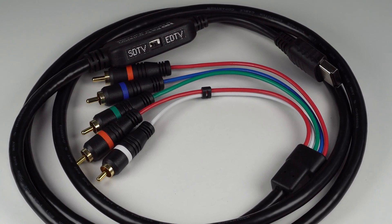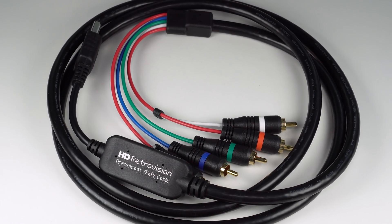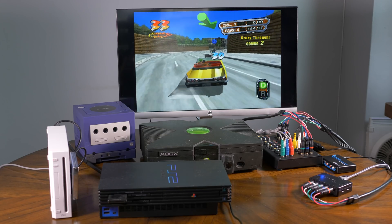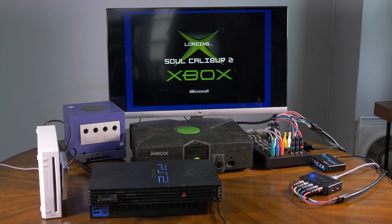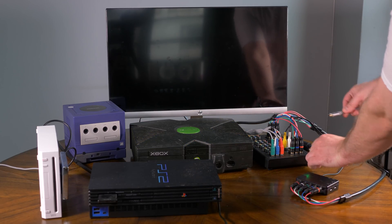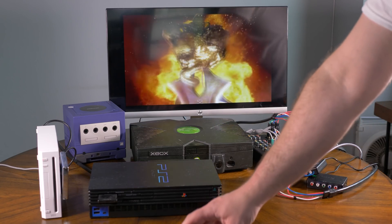Same goes for the Dreamcast — 99% of the library is 480p compatible, but if you really love those few 480i-only games, the upcoming HD RetroVision cables and the Tink-M will be a decent choice. If you just care about 480p stuff, there are a few options that are probably better though. The original Xbox supports 480p natively on most games; however, there are about 20 that are 480i-only without a hack. If one of these is your favorite, the M might be a great choice for its de-interlacing as well as its pass-through. The only downside with the Xbox is there are about 50 games that also natively output 720p, which the Tink-M doesn't support. Using a basic analog-to-digital converter, an internal mod, or the chimeric cable might be a better option for the Xbox, but all of those are a separate cost. If you've already got quality component video cables and are planning on getting the Tink-M for your PS2 anyway, it's nice to know it's at least an option.